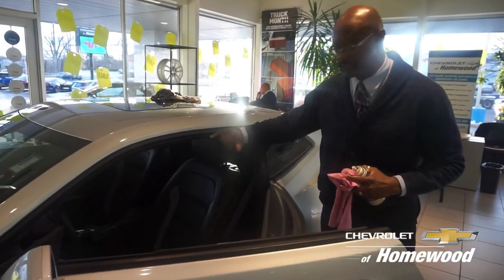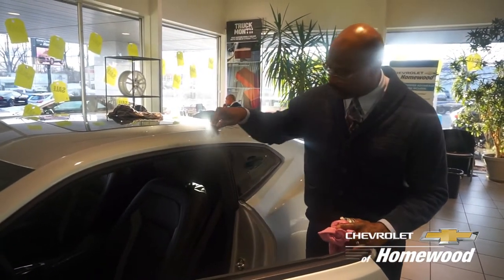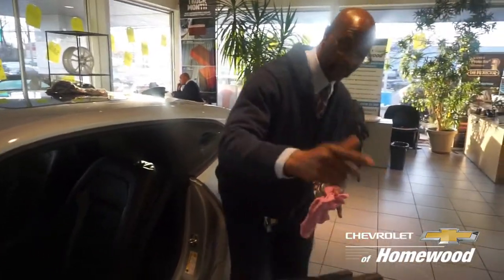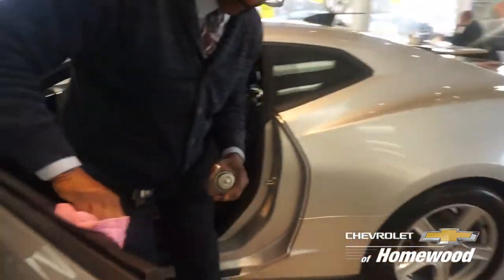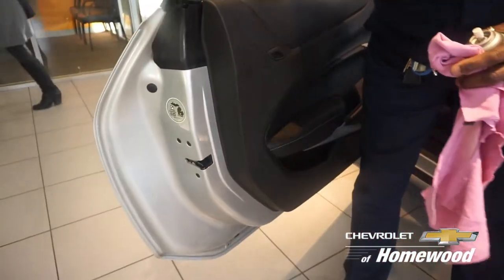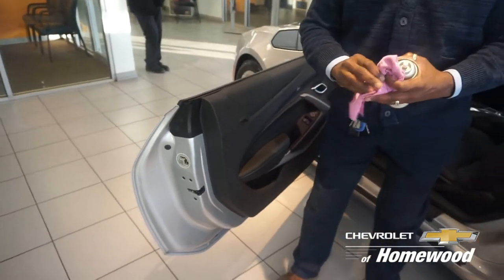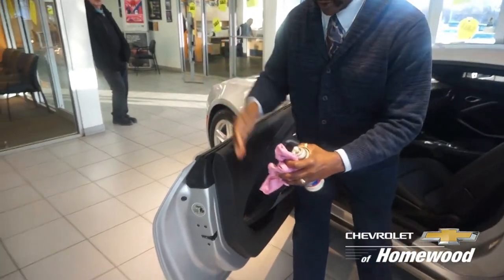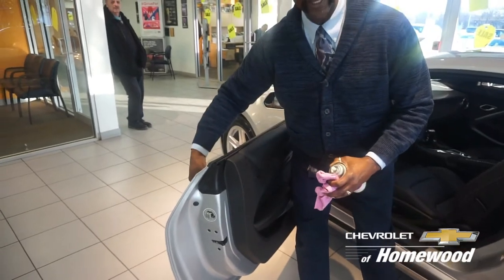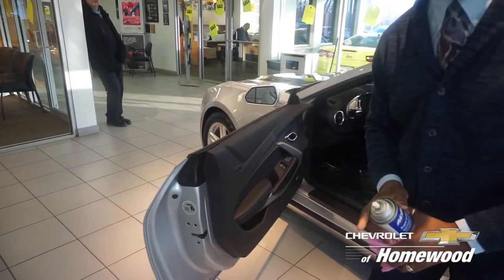You have two problems. One is that issue. The other one is if you wash the car and it gets extremely cold, water runs down into the door latch. So when I open the door, it doesn't unlock — it doesn't open. Those are the two major causes of a door being stuck shut. The water gets in the latch and freezes. You can also spray the lubricant on that latch and that'll keep that from occurring.